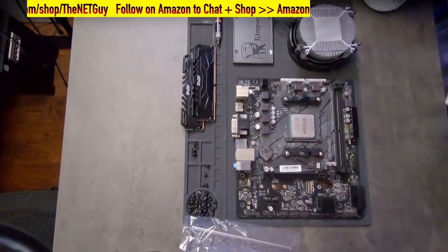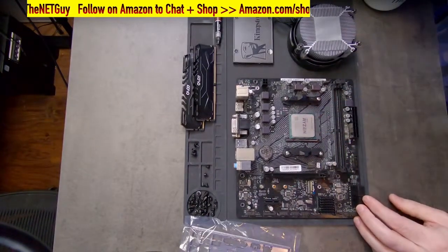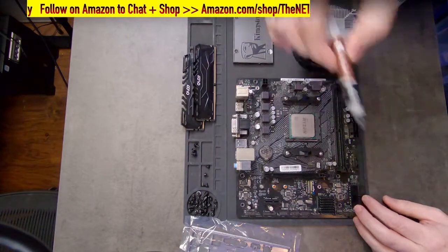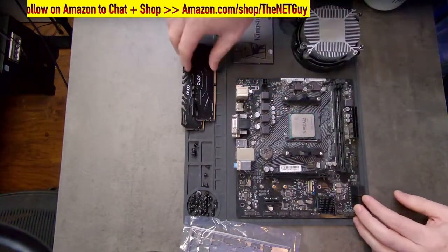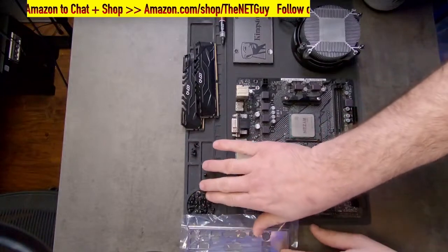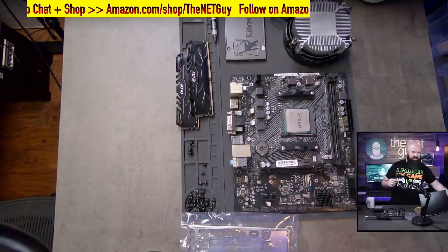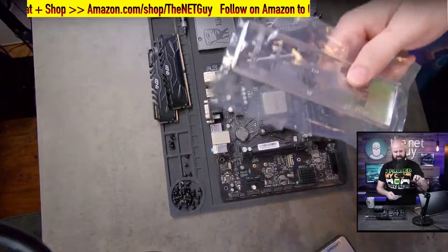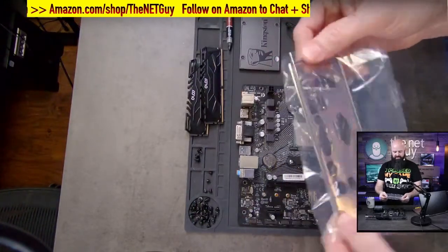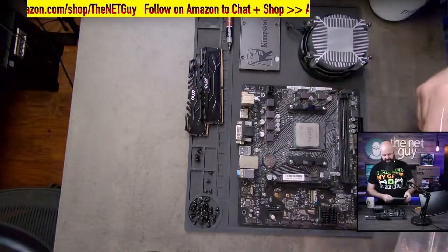So these are the parts that we have here. This is the motherboard, and I've already taken the liberty of installing the Ryzen 5600 chip. This is the cooler that comes with it. Now, normally they have a pad here, but I've taken this on and off a couple times. So I'm going to use just some thermal compound. I'm going to use the Noctua stuff here. And then this is the memory that we have, and I'm going to show you guys how to install all of this. There's a bunch of screws that come over here as well. So when you set this up, you're going to get a bunch of screws, and they do have different sizes, but we'll talk about what each size of screw essentially does. And then let's look at this guy. This is your back plate for your case. So this is your IO shield, and this is going to have spots for all of your IO to stick out on your case, and keeps the dust and debris out of it. So that's a quick tour of the parts.